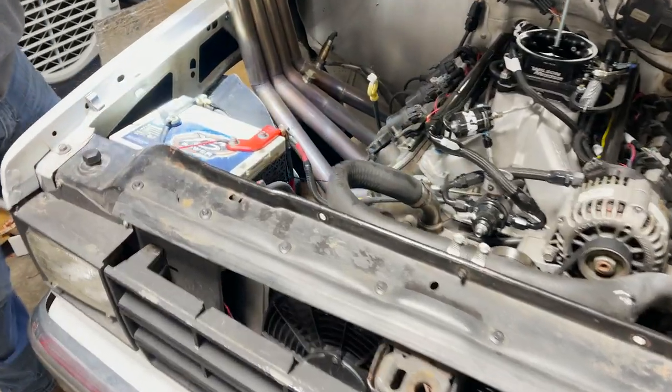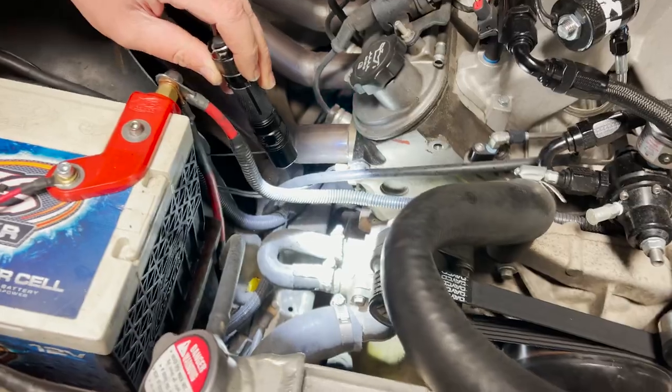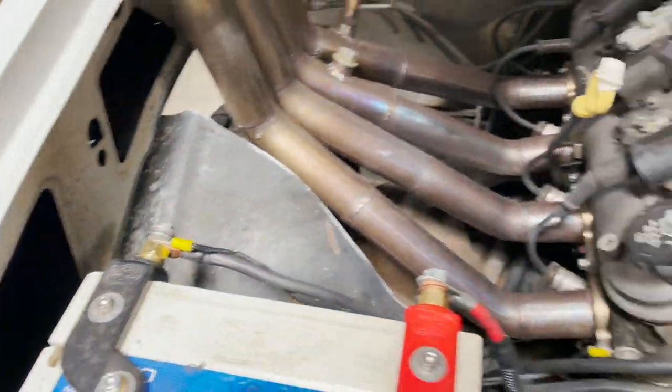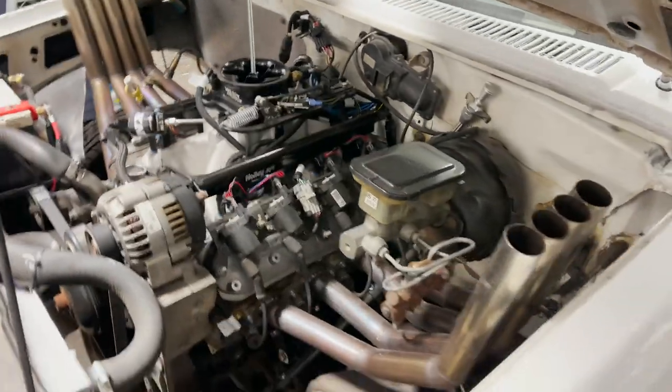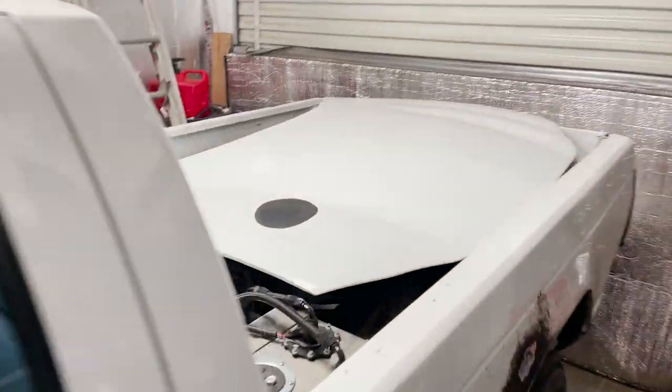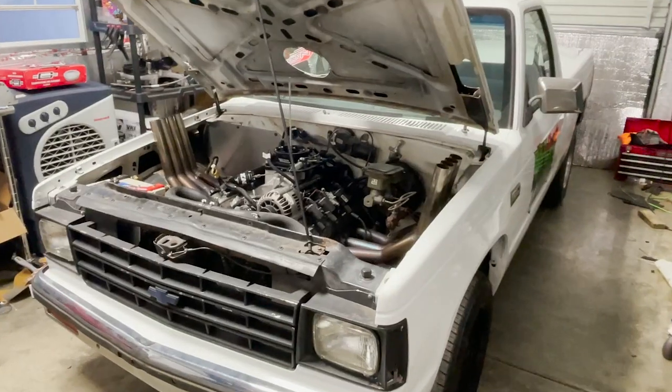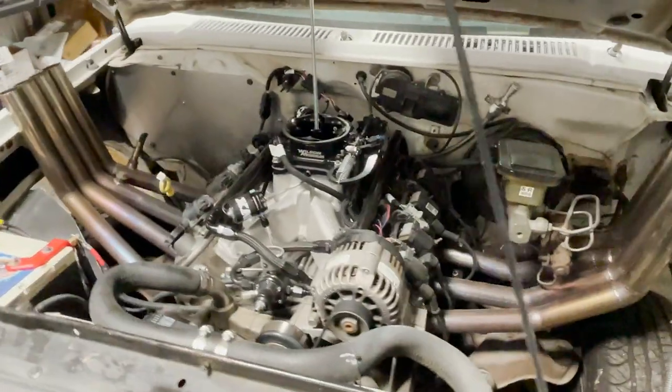We got started, so now it's time to prep Bernie for Cletus and Cars Houston. You can kind of tell where we're getting a leak on that antifreeze — you got a little bit of smoke coming up from this area from it burning off. You can kind of see it right there. We'll look at all the hoses, make sure all the connections are good. Last time I lost the little bolt that goes there, so I need to grab one at the parts store. We're going to grab some oil and a new filter, and I'll need to get the hood from the Camaro out of here, get some tires — those ones were cooked — and fill up the bottle. If you're new here, this is Bernie, our 1986 Chevy S10 with a 4.8 liter LS on some nitrous.